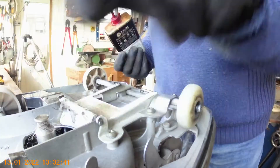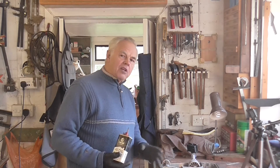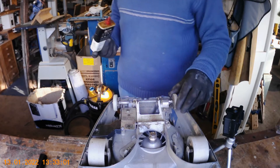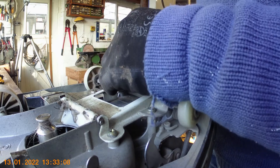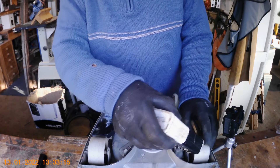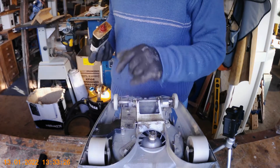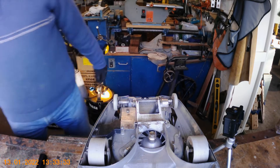On all Hoover models it's always a good idea to oil the wheels. Listen to this — they're noisy. You can spend hours doing a really good service, greasing all the motor bearings, getting it running beautifully mechanically, but forget to oil the wheels and first time the customer uses it it's noisy — not good. Just pop a tiny bit of oil on the wheels. Don't put too much on because it'll get on the carpet. See the difference — before it's noisy, after it's almost silent. You only need a tiny tiny drop. It's very important to do that.